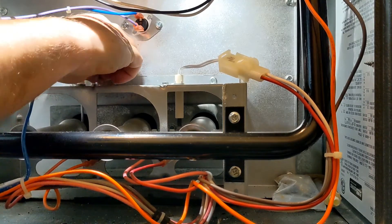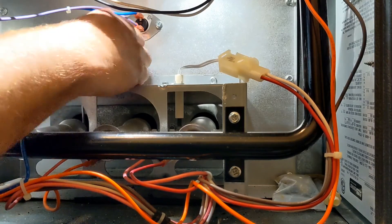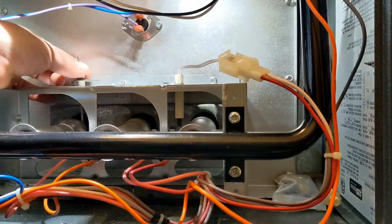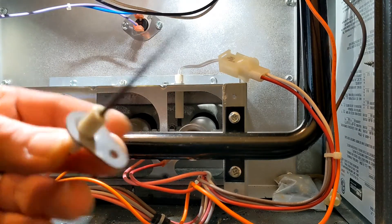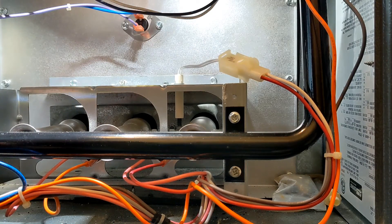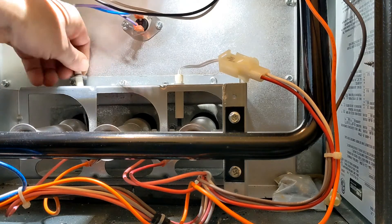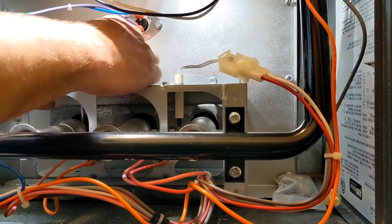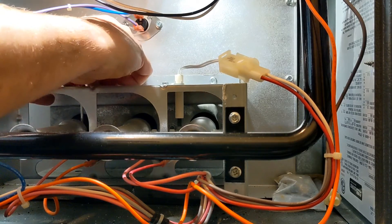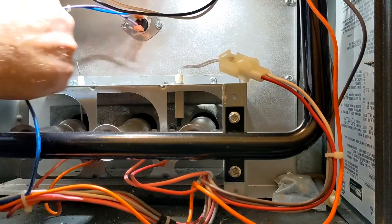So you just take that thing out. Go ahead and pull your wire off there. Get that screw out. The thing slides out just like that — and this is the same one I had in my hand earlier. Take it and clean it with your dollar bill, or your brush, or your sandpaper, or whatever you've got. Slide her back in there. Make sure it's straight. It's in the hole like it's supposed to be. Make sure this screw is tight — tighten it down because you don't want the thing bouncing around in there.